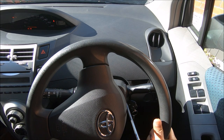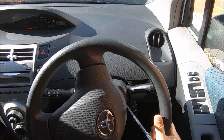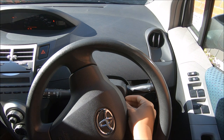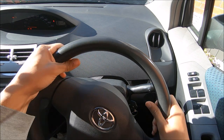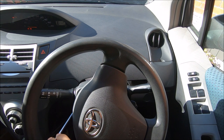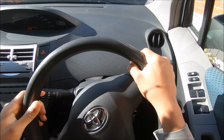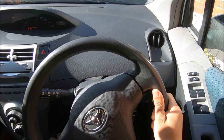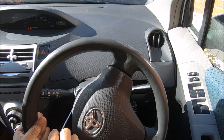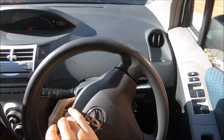Another point I didn't mention earlier is it might be worth checking your headlight bulbs as well. But given that both bulbs are not working, it's safe to assume that the headlight bulbs are not the issue. It's not particularly difficult to pull out the bulbs and use your multimeter on the ohm settings to check for continuity between both circuits. I have seen vehicles where both the left and right bulbs fail — normally one side fails a month or a couple of weeks prior and people don't notice it because one light is still working, then when the other fails they notice.